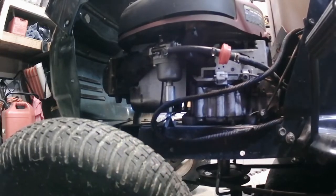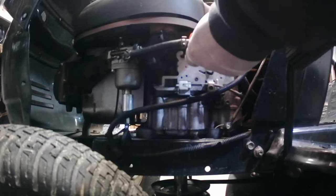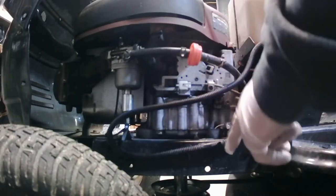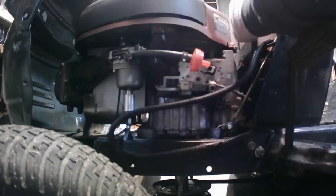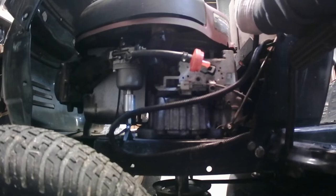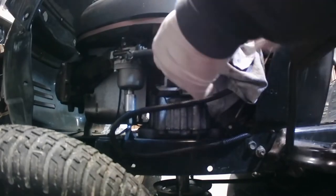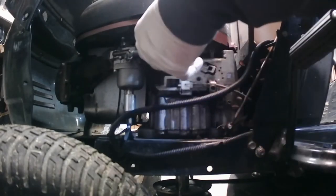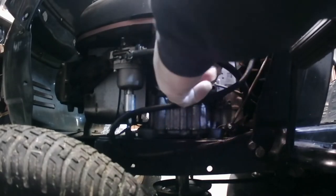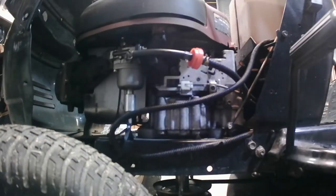Let's get this fuel filter replaced while the oil is draining. This is going to be the gusher here, so I'm going to try to get this thing off and pulled up. I'm not going to worry about this little bit of gas in here. I'll put the big side toward the fuel tank. Let's see if I can jam this in here, just to hold this baby here for a minute. I used to put this one on backwards last time. Yeah, we got her. I forgot about replacing that carburetor — I got around this side and thought, oh yeah, I forgot about that.